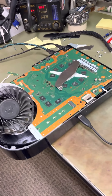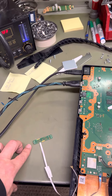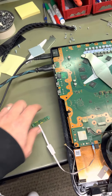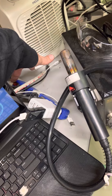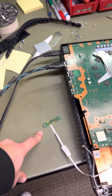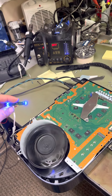We have this PS5 right here that has a classic three-beep-off issue. The symptoms on these: when you plug in the power, the light on the console will light up blue automatically, which is not something it's supposed to do. Then it'll give you three beeps and actually turn off. Once you turn on the power, the blue light will blink — that's not normal — and then it'll go to a white light, but it turns off with three beeps and shuts off before that.